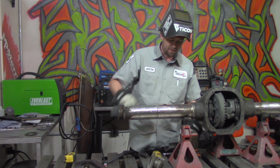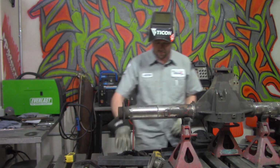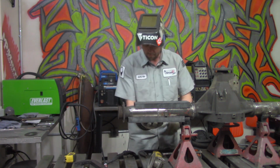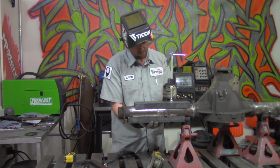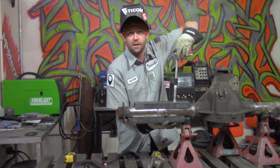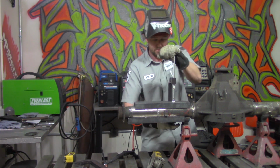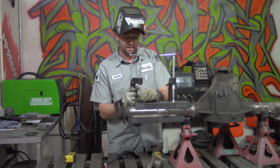So we're going to reset our clamps here. I'm going to flip this up with our welds on the top and bottom now, just so you don't get confused. We'll reset our clamps the exact same as before. We'll clamp them down nice and tight, and we'll check our measurement yet again. If it's off, we've got to cut it, we've got to fix it, we've got to change it. And actually make sure it's accurate, correct, true, all the rest of that good stuff.